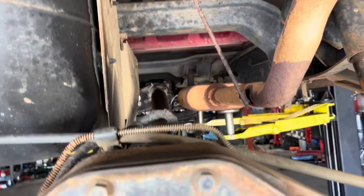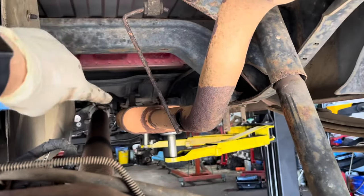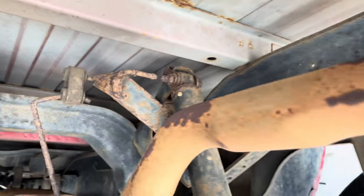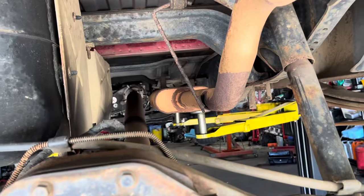Make sure you hit all your u-joints with grease and check for any issues. My exhaust came apart not long ago, so that's got to go to the exhaust shop. Plus the muffler is broken apart on the inside. Other than that, the rest isn't too bad underneath here — she's good to keep on trucking. We just have to get the exhaust fixed when we get some money. Now let's get on to the oil change.